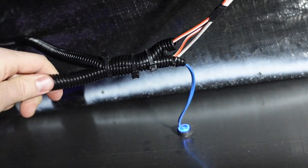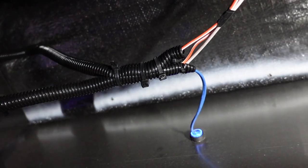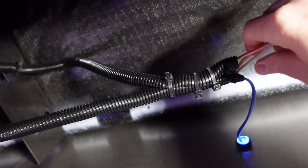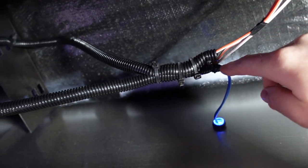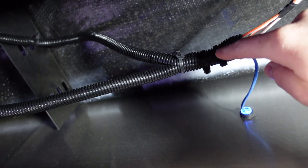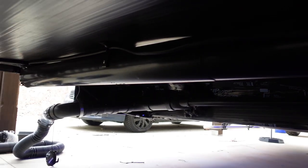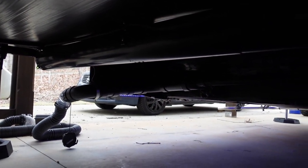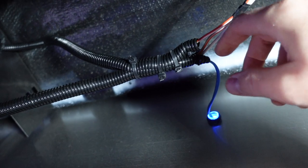I like to use this wire loom that protects the outer jacket of the cable, just in case road debris comes up, and lots of tie wraps to keep it together. That's your first connection running from the 12-volt step light all the way down to your blue LED. I did the blue LED strip on both sides, so I also ran a second wire — same 16-gauge wire through wire loom — that goes across where the sewer storage is, all the way to the other blue LED strip on the other side. I use this junction as the main 12-volt supply for both sides.